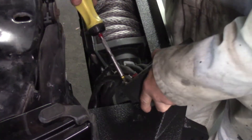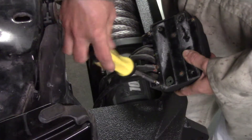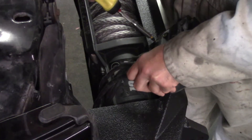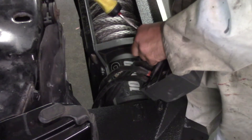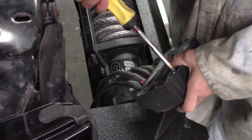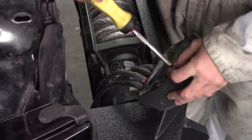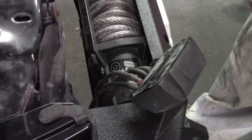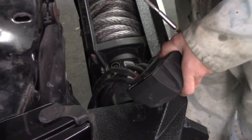The brackets themselves are made out of stainless steel too — I just happened to have that strapping laying around. This is a bit of a pain, but quite frankly it's not something you do on a regular basis. Theoretically I should never have had to do this. At the very beginning of the video I mentioned that this power cable from the factory had much nicer cable armor on it. When I installed this the first time, I installed supplemental cable armor over the positive power lead and was very careful about how I routed it — that's why I'm not swapping the whole box out. I'm only swapping the connections on the new box to the old wiring.